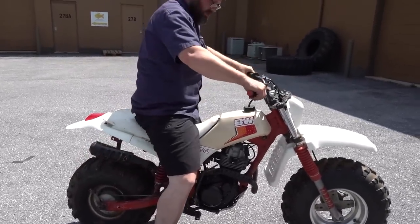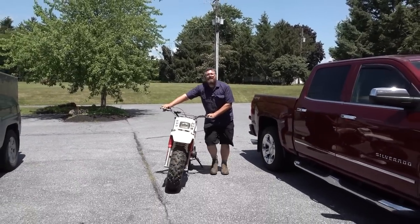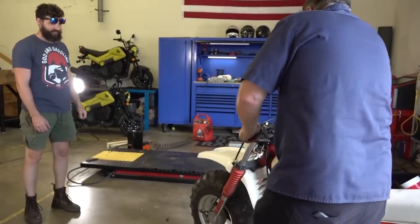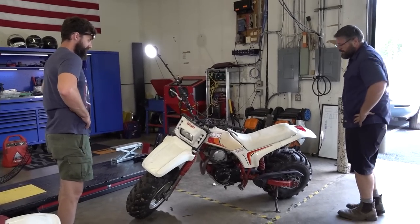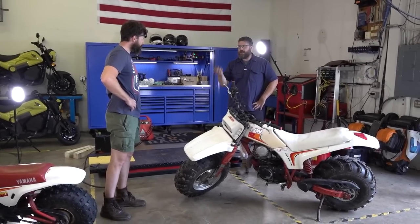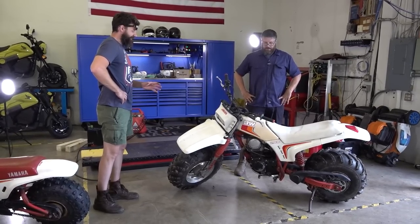But let's build an awesome, amazing ramp. Might need to adjust that arm of hair. It's hot out there. It was running okay until it wasn't. What happened? I found two vacuum leaks on the carb. And I plugged them and it fired right up and was running pretty good. But now it died again. The idle screw was backed out all the way. So I added some idle screw to it. But well, take a break on this.